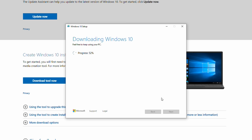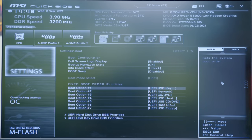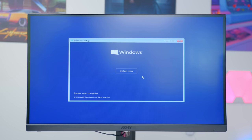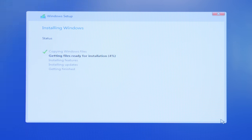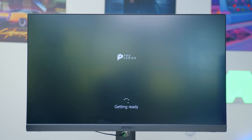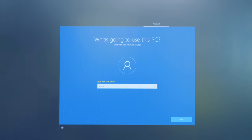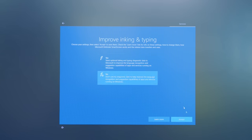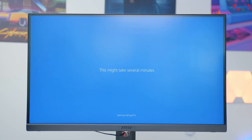Once you've done this, head to the link in the description below to generate a bootable Windows USB drive. This basically turns any 8 or 16GB USB flash drive into a drive you can use to install Windows. Plug it in, exit the BIOS, and you should automatically jump into the bootable Windows USB. You'll be asked to agree to terms and conditions, choose a drive to install Windows onto, and answer questions about data privacy, location tracking and all of that. This process can take anywhere between 20 minutes and an hour depending on your system spec and storage speed, so be patient.